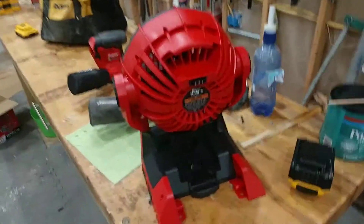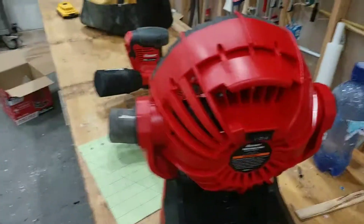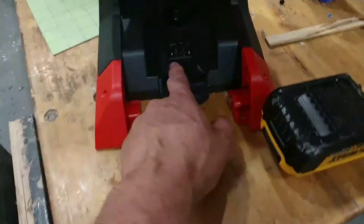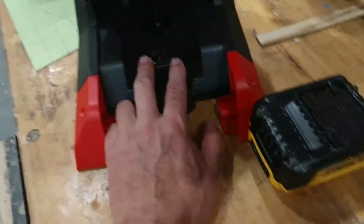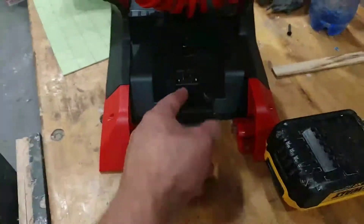I'll try to make this short. There are a lot of videos out about the DeWalt batteries and the fans and the Bauer tools, but what I've noticed is like this one here — I use a 10K ohm resistor between the third and the negative inside.